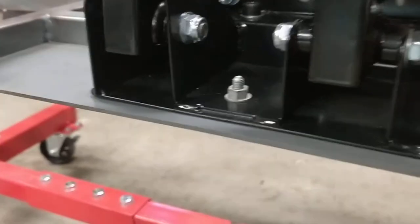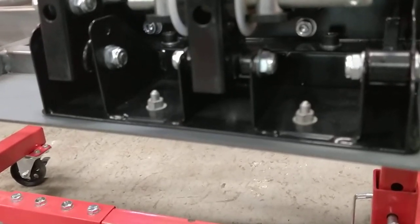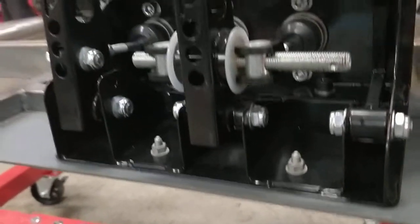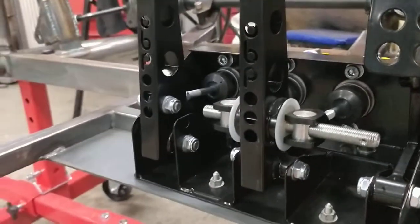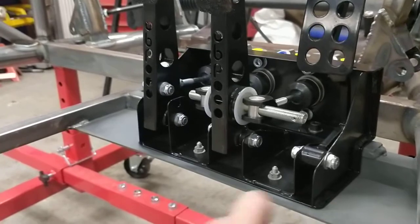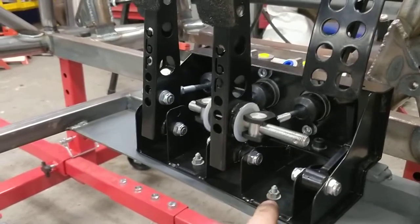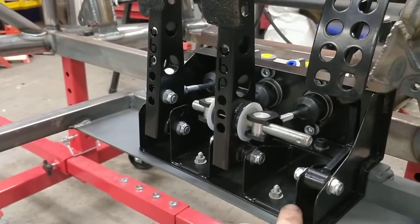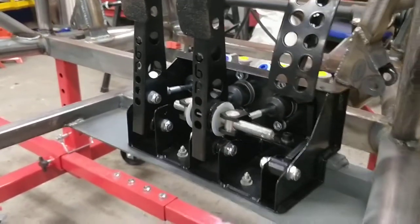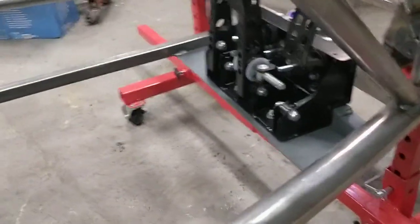Because I've now drilled and tapped it, my mounting bolts are right in the middle — I've got two of them at the back, one there and one just peeking up there, bolting down into that section. There are also two bolts at the front. These are only M6, so I've got M8 at the back and M6 at the front. Bear in mind the premium box comes with four M6 bolts, but after talking to the boys up there, they felt the middle pedal wasn't getting enough support and was potentially lifting off. These two M6 bolts are temporary, placed either side of the brake pedal where you're most likely to get more pressure. It seems extremely secure now — it's not going anywhere.